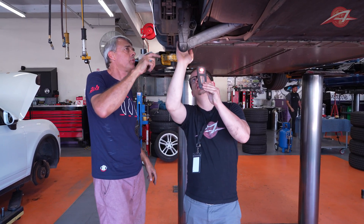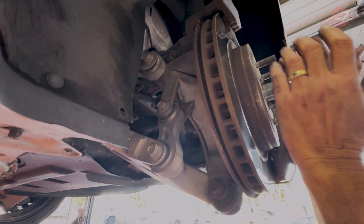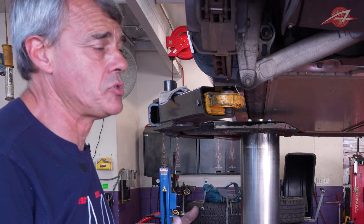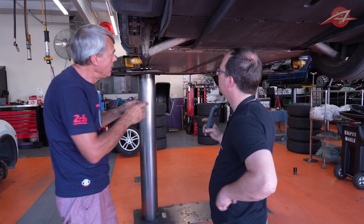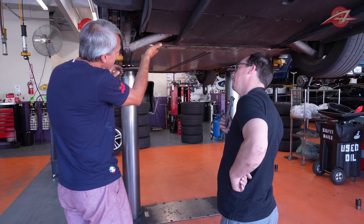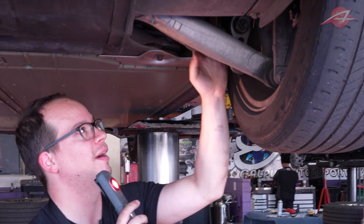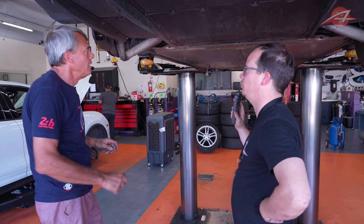The integral link goes under compression when braking and into tension when accelerating. Tesla didn't have the money to tool up and make the very fancy control arms you see in other cars. So to save money, we designed this control arm to be the same part on the left and right side — take it, flip it over, and you have the right part. It's exactly the same part. That meant we only had to make one tool and we get two sets of parts out of it. As far as I'm aware, nobody had ever done that on this suspension design before.